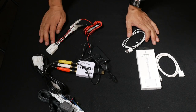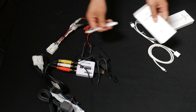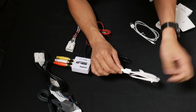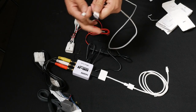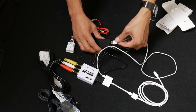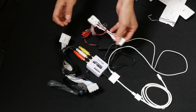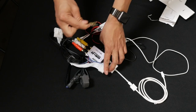After all the components from the IF-02EP are connected, get a hold of the products you purchased separately. Here's the Lightning AV adapter. The Lightning AV adapter will connect to the other side of this HDMI male connector, which connects to the Lightning cable extension cable, because the original is too short to route inside the car. The other cable is the Lightning charger cable — connect it from the Lightning AV cable and the other end connects to the USB. The remaining two connectors will be plugged behind the radio in a daisy chain. There's also a ground wire that we need to ground on the side of the radio system.